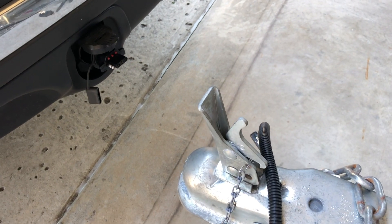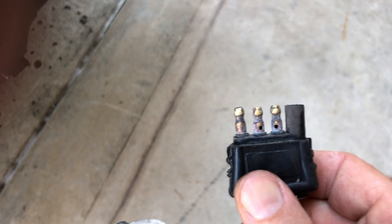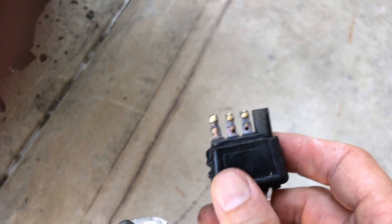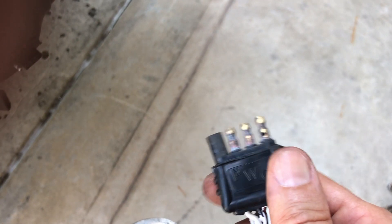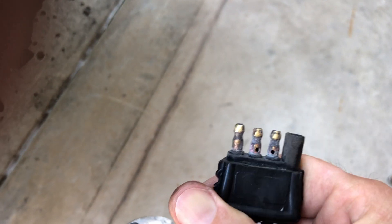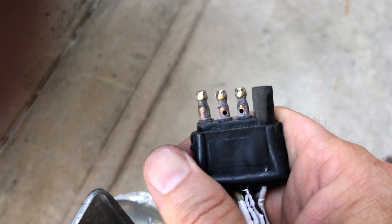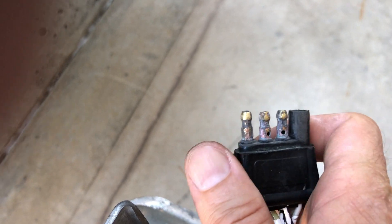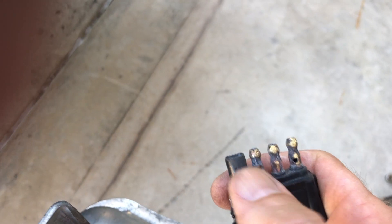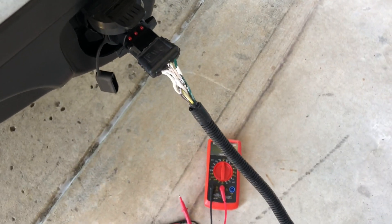What we're going to do now is follow that electrical path all the way back to the light bulb on the end of the trailer. We live here on the Gulf Coast and we do all our boating in salt water — the salt air and salt water take an effect on connections. Try to keep your electrical connections clean, much better than I've done here, but this can be done with sandpaper or proper cleaning tools.